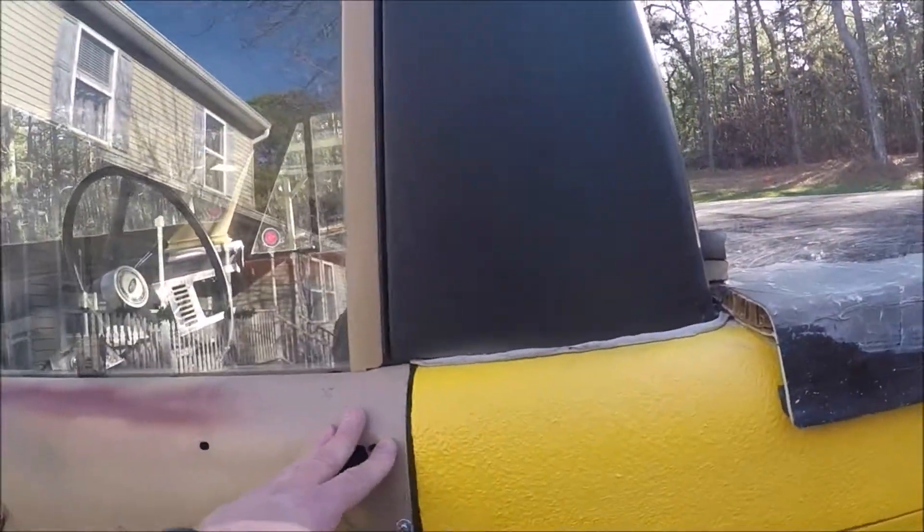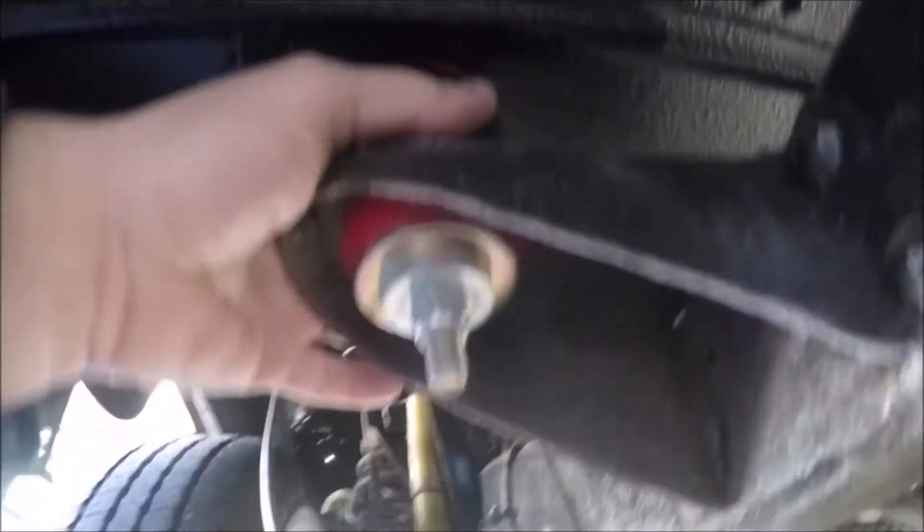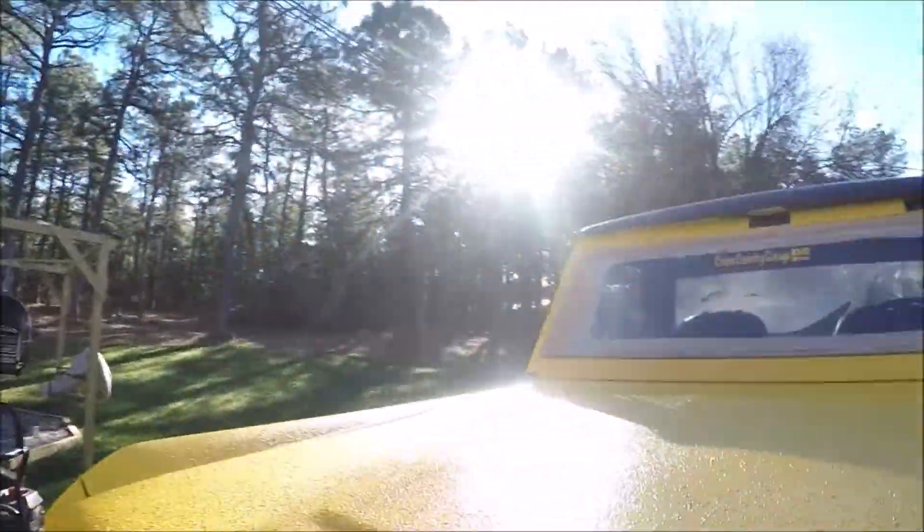Underneath, it's old and it's got rust — it has been coated here and there. We've got a custom flex pipe on the exhaust — beautiful. Here's the fuel line, which touches the exhaust, so that's going to have to be fixed. The front's not bad. New floor, new body mounts. Missing one rocker on the other side. Frame in the front is rusty and crusty. It does have power steering, which is a bonus.